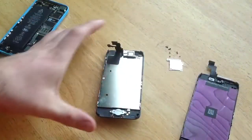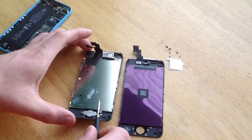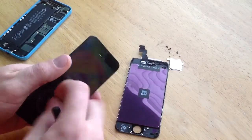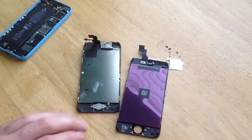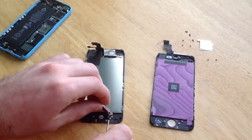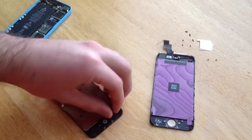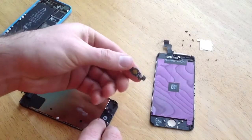I'll draw some attention to this: if you have purchased a screen offline, as you guys can see, this old screen has a little back cover and the new one does not. You will need to replace it since it's not there. Go ahead, grab the Phillips and take those screws off. I will remove the suction cup and the two screws — one, two — and replace them. Once the two screws have been replaced, go ahead and lift up this black part. You can see it's connected to this little black piece here. Very carefully go ahead and lift up — it's on a sticker, so be very careful. It should peel right up, and just like that, that's what it looks like — the little sticker.